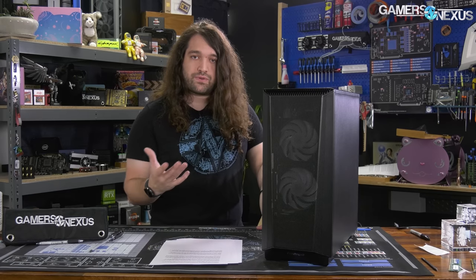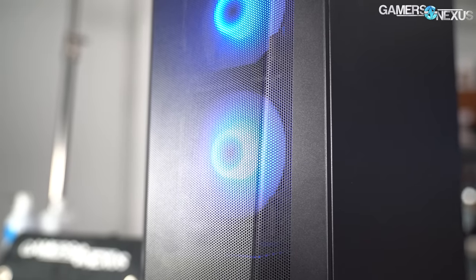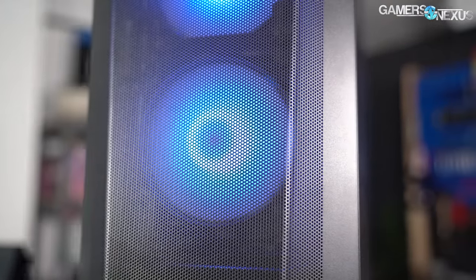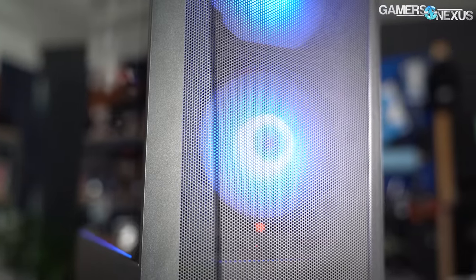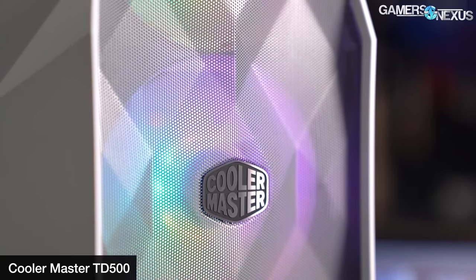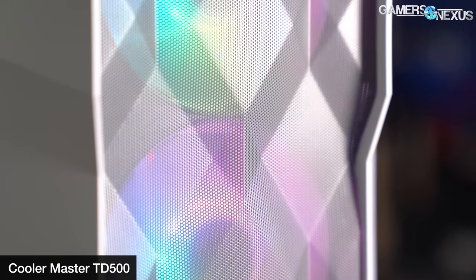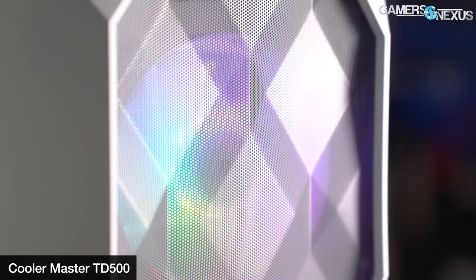This reuse of tooling keeps the case cost and MSRP down while still allowing differentiation through new plastic parts like the front panel. There's no second layer of filtration on this one — no discrete filters behind the front panel; the panel itself is the filter. We've seen this with the Cooler Master TD500 as well, and we believe it's an ideal compromise between price, protectiveness, and breathability. Dust sits on the outside, which people are more likely to wipe down.